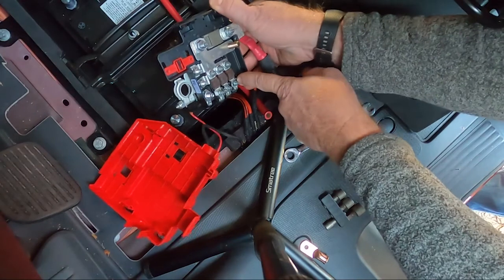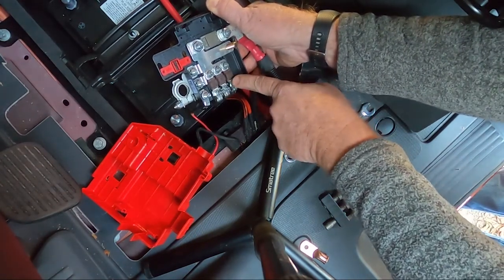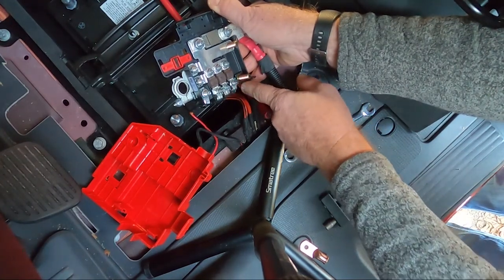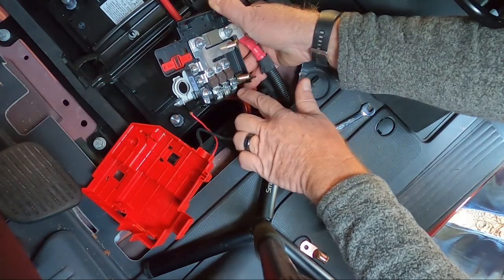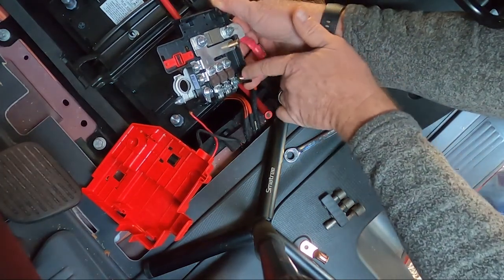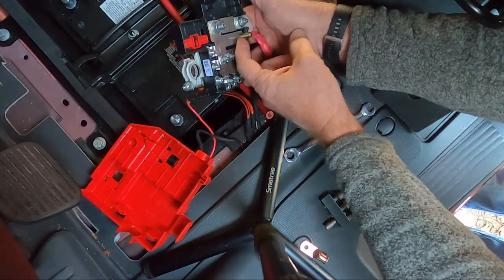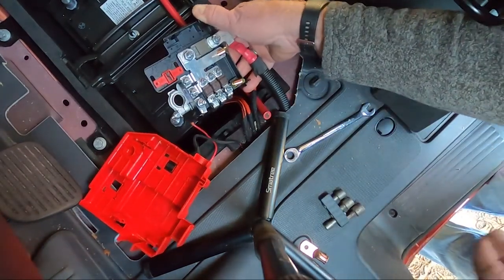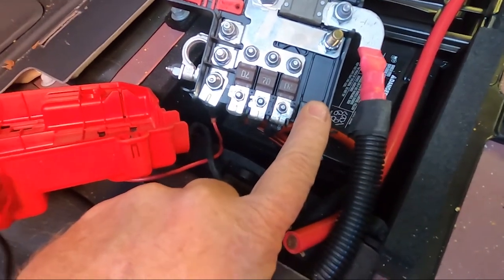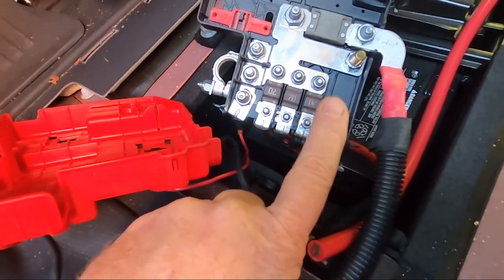You can try and reshape — this is the upfitter's connection, it's a 70-amp fuse, but it's a very narrow little terminal so you'd need a lot of grinding. Or you can just do this and add what you need — it's a little easier. I might have to shave these posts off — I'm not sure if the cover is going to fit. I verified that the 5/16ths threaded square-head bolt, one inch long, does fit underneath the cover when everything's snapped down.